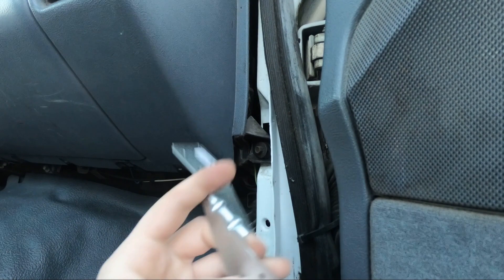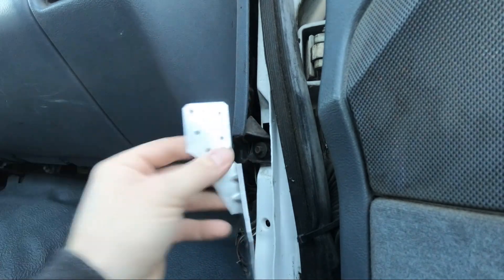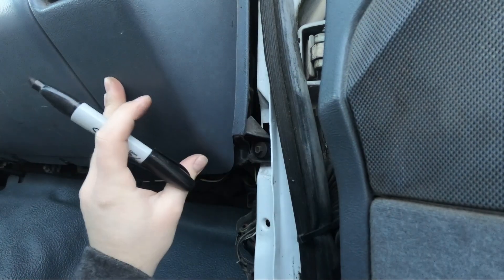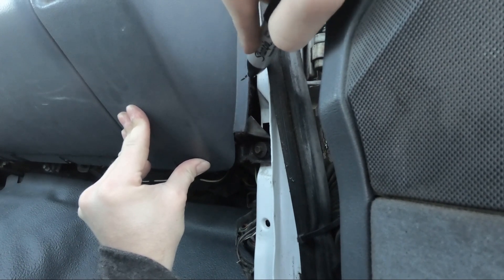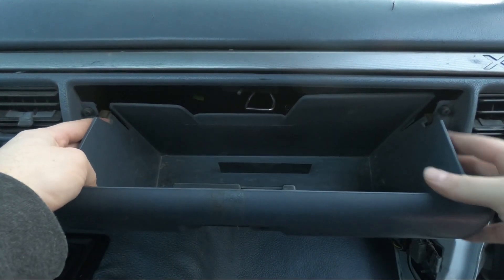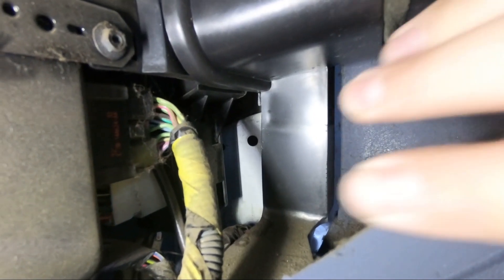The plan is to take this angle bracket, chop off the big square pieces, and just leave two little sections so it should fit nicely. Since the dash has sagged quite a bit, I want to push it up and mark where it should be. Let's remove it first — just pushing these little tabs, it pops right out.